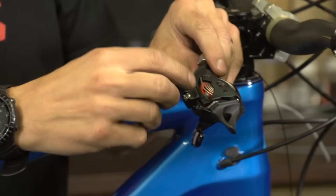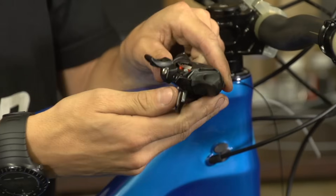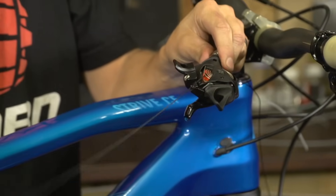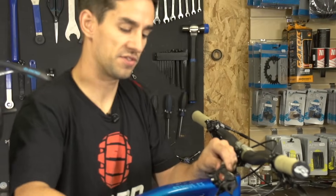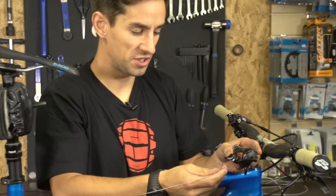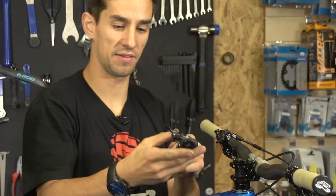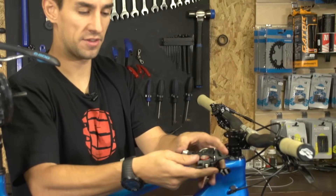Because I put it in my highest gear, you'll see that cable end just there. If you can't see it, it might be because it's clicked a bit further around, so just knock it down to your highest gear, and then give that cable a bit of a push, and out it pops. So just slide the old one out, and it's just reversed that procedure to put the new one in. Just make sure as you're doing this, you're not kinking the cable in any way, because that's gonna give you friction in the outer cable.